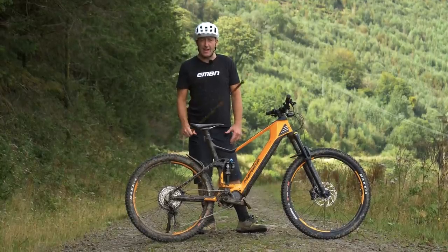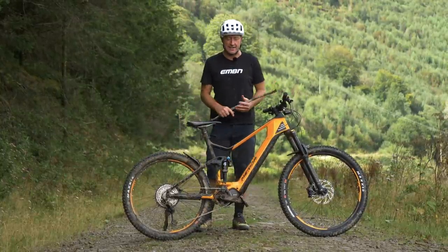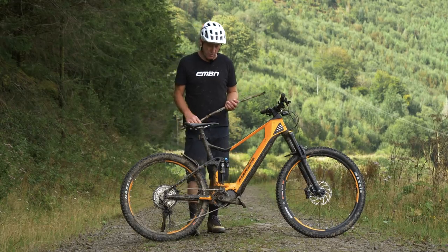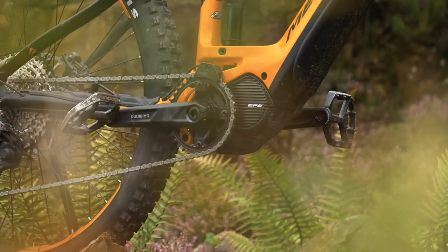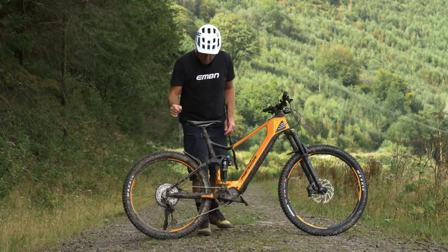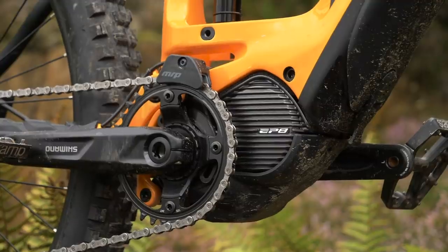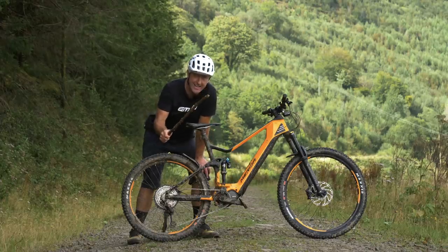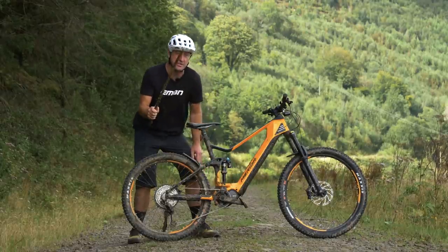The stick is back. We've rattled on about the fact that it's 20% more powerful, 10% lighter, and with 36% less drag in the system. What else about the fine details of this Merida E160 with the EP8? Crank size: it comes with 160mm crank length along with 165, 170, and 175. Three chainring sizes up front — 34, 36, and 38. It's compatible with 12-speed and all the other speeds. It's got a neat chainring guide, plus the same engine mount pattern as the E7000 and E8000.